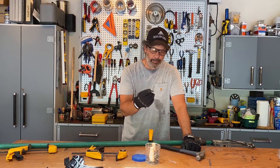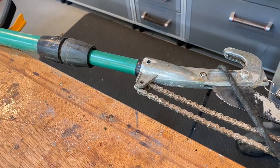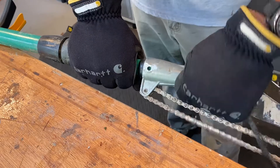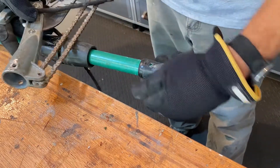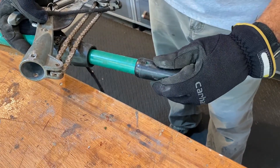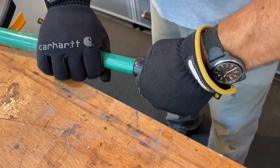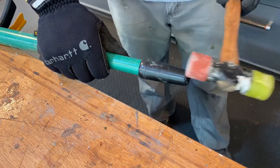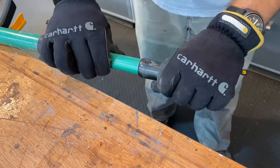Here's the pin that was the factory-installed pin. Upon further inspection, there was no easier way to get that out — I made a good guess. Now I can remove the old head assembly. I grab the shaft and the assembly and twist — there it is, it came off pretty easily. It just sits on this rubber tip, but I can see the tip slid down a little bit, so I need to push it back down with a mallet. There's the hole — good clearance, ready to go.